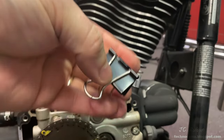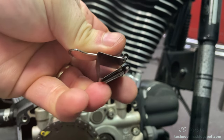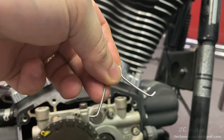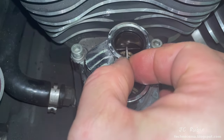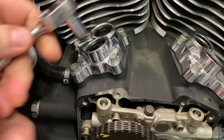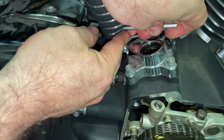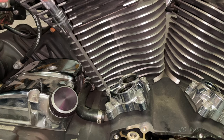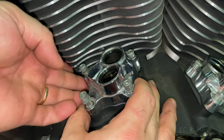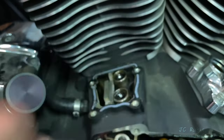We'll be removing the lifters for inspection. If you weren't removing them, you'd need to hold them so they don't fall in as you remove the cams — a clip can be used by removing the metal brackets, inserting them, and using spring tension to hold one lifter against the other. We will be removing them. The lifters are held in by four 3/16 hex bolts. With the rear ones it was easy to break tension with the hex key, then the whole block lifts right off. Break off those two tabs on the gasket before they fall into the engine. The flats of the lifters are held in place by a small round cylinder, which is now removed.